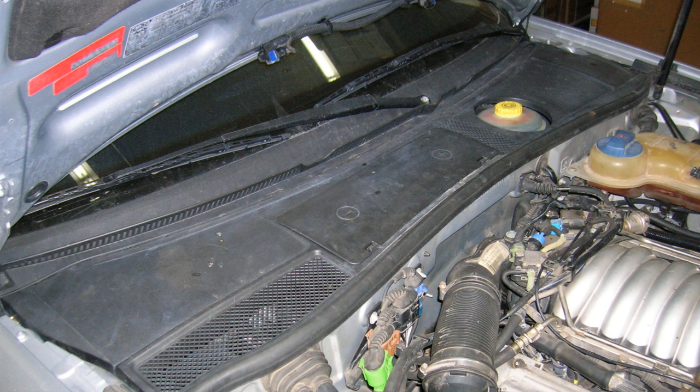Elevate the engine RPM between 2,000 and 4,000 RPM at a gradual rate for approximately 10 to 15 minutes. You might have to turn off the engine and allow the engine to cool for 20 to 30 minutes, and then repeat the previous step to allow proper burping and removal of air in the cooling system. Allow the engine to idle until the lower coolant hose of the radiator is hot. This is an indication that the thermostat has opened and the cooling system has been burped properly.